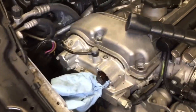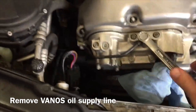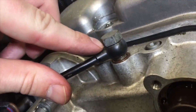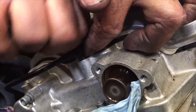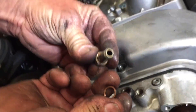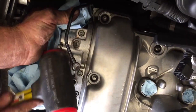The reason we're taking these two off is so that once we have the valve cover off and want to disconnect the vanos from the camshaft, we can push on the shaft to make it easier. To get this other cover off, we're going to have to disconnect this line. When you break it loose, make sure you hold on to the line, otherwise it's going to move on you and you can bend or break it. Be really careful — you've got a crush washer in here, then a banjo and another crush washer. This system makes 1800 PSI, so you don't want to lose those crush washers. Once loose, make sure you don't back the bolt all the way out, because you might lose it when you tap the cover off. Put your rag under it and tap the other one off.